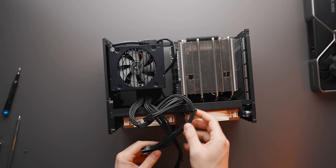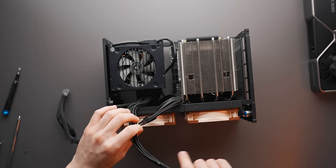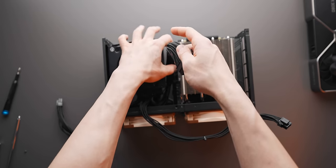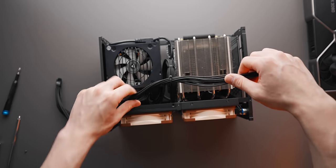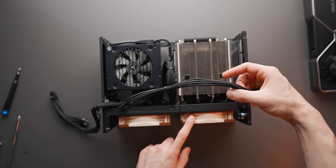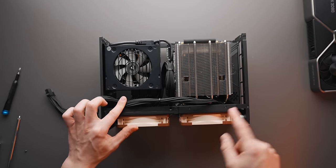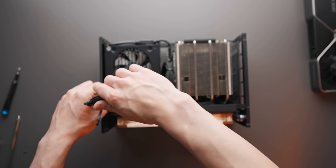Before running out of room, let's manage these cables. The GPU cable goes to one side, the CPU cable plugs in there. The 24-pin motherboard cable is the chunkiest — in the T1 it wraps behind or next to the power supply, folds down, and plugs in at the bottom. The CPU cable is a little tricky since the cooler and fan are already installed, so you have to bend it a little and press it in — if you have trouble, just remove the fan temporarily. Feed the GPU cable through ready for graphics card installation.